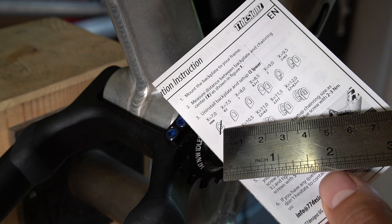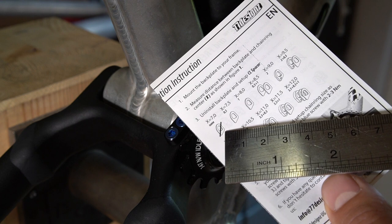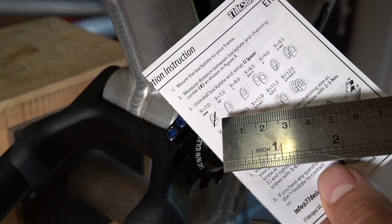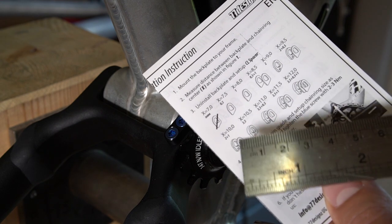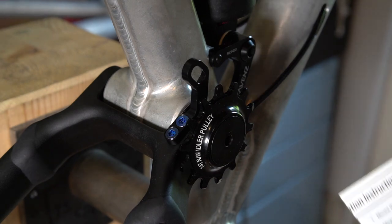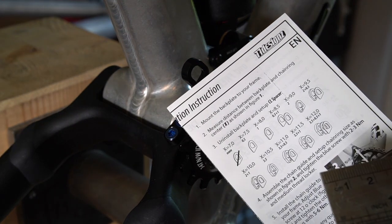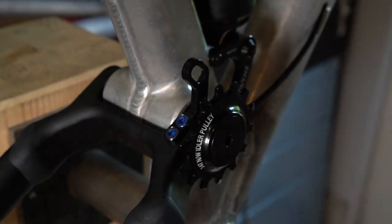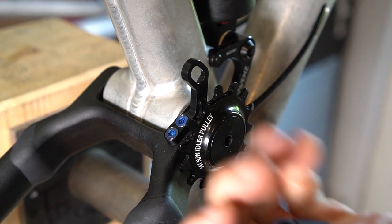This is for the 49 millimeter chain line. If you have a boost chain line, you can consider probably +3. You need to add the bigger spacer behind the idler pulley and reinstall it. Then you would need 3 millimeters of washer, right? As we need none right now,